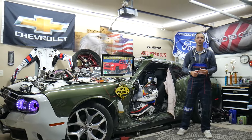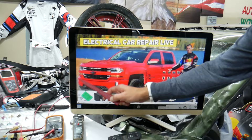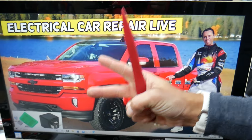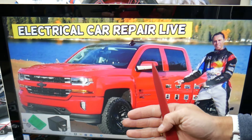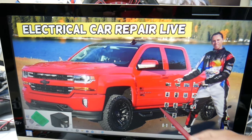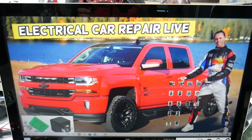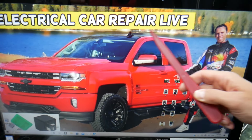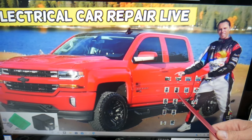If you have no sound coming from the radio or speakers, we'll demonstrate on this generation Chevy Silverado. The first thing you want to check is the two fuses for the radio and the sound amplifier. Even if they look good, pull those fuses for about a minute to let the system reset, then plug them back in. Most people don't know how many hidden fuse boxes are in that generation Chevy Silverado — check out our video on fuse box locations.